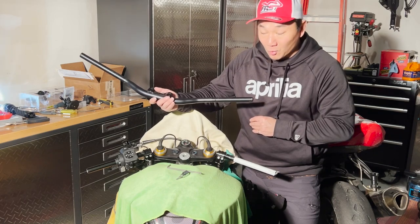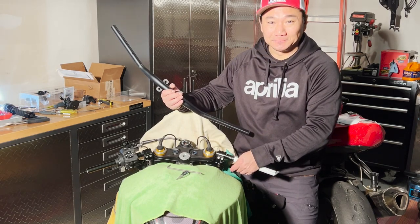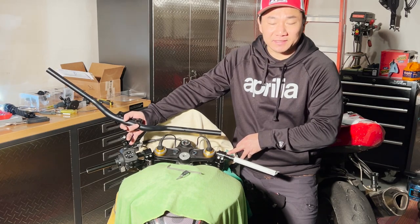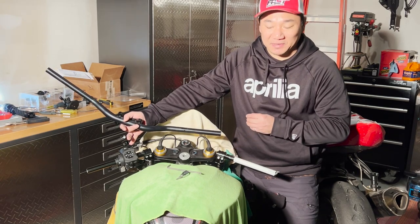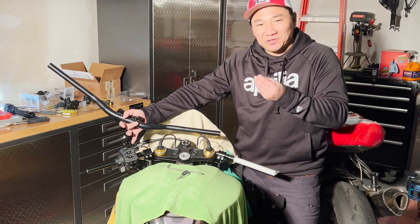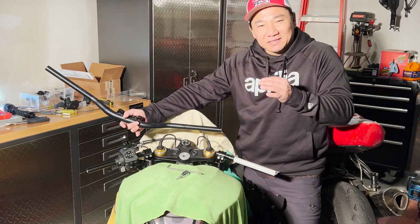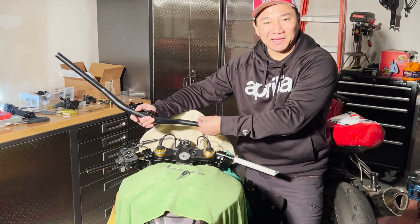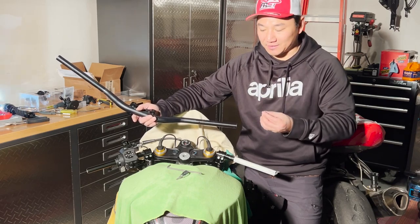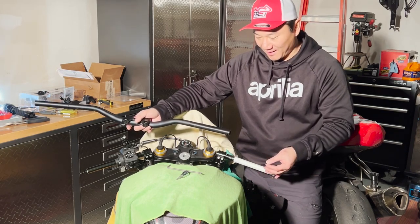Now, the ones that I thought were for the control for the menu and the start and switch kill button, they're not there necessarily because they use a different tightening mechanism. So this bolt here, M5 by 0.8, actually screws onto a clamp inside the control, and the more you tighten it, the tighter it becomes to wrap around the handlebar so that it doesn't slide or rotate around the handlebar. That's the trick. Now here is where the realization comes. In any case, I think all is good.